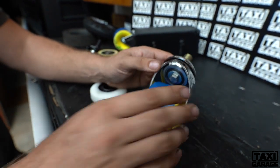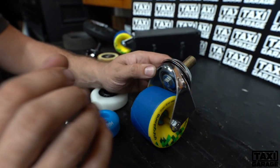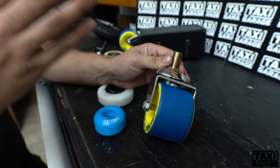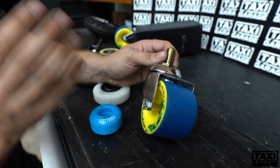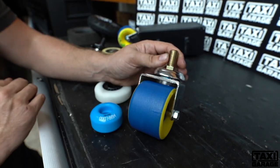With these wider wheels, bearings, and caster setup, this allows for more grip in the back of the cart. More grip is better — translating the same thing as with a car. As you have more grip, the cart is faster, more controllable, and lasts longer because of the contact patch.